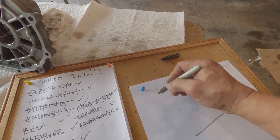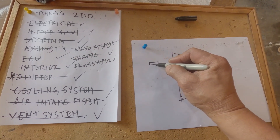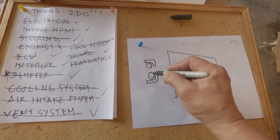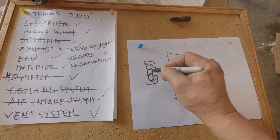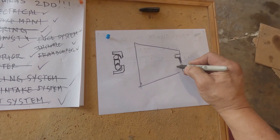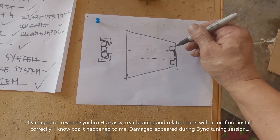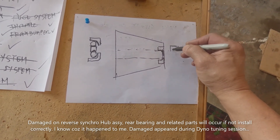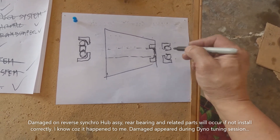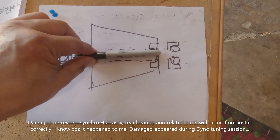This will be the rear case, and right there — now the bearing. This is the side view of the bearing: the outer race is like a cup. Then you have the ball bearing here, and then you have the inner race right here. This side has to face the rear, so it will be something like that. And then your input shaft is right here. What will happen if you put this thing backwards? If somehow you don't know or you're not sure how to put it on — let's just say hypothetically that you put it on backwards.